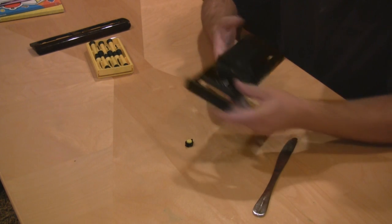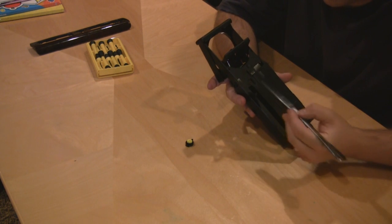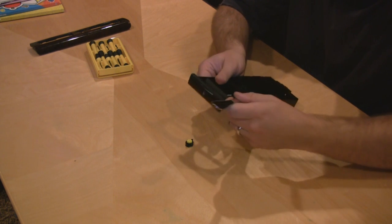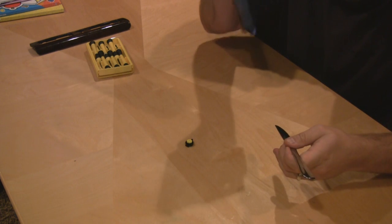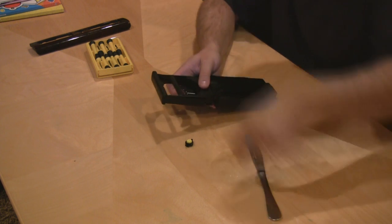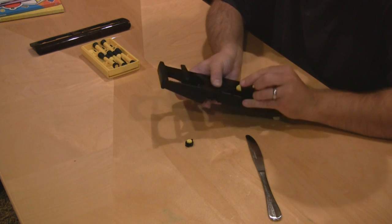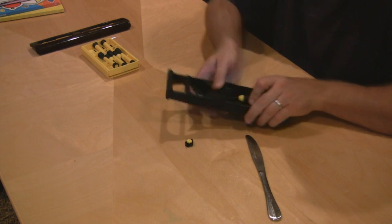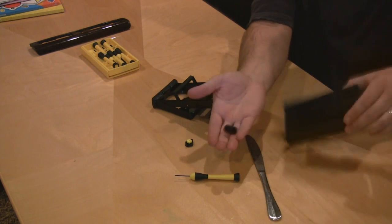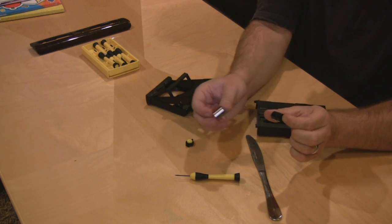When you open this next, you'll see that there's also a rubber stop here to keep it from flying all the way out. You can take a tool like a small flat-bladed screwdriver, pry it under here, and the whole unit comes apart. Now it's in two pieces — and guess what falls out? The constant force spring and a little cylinder on which it rides.